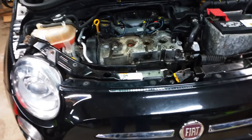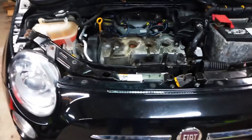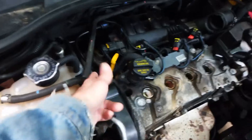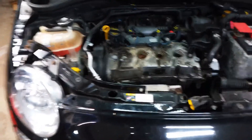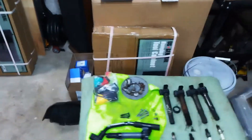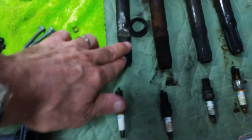Based on the research, it was more than likely an issue with the multi-air oil screen filter, which is hidden down on the side over here. We replaced that but still had issues getting it to start properly. So we pulled the top off, pulled the coils out, and we're going to flip over to where we have them right here to show you what we actually found. These are in order that they came out.